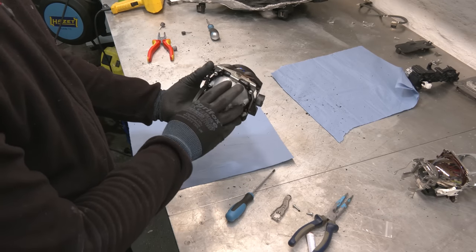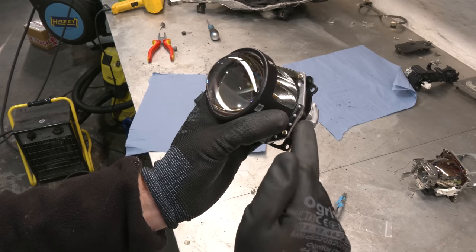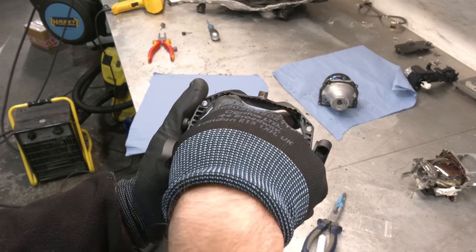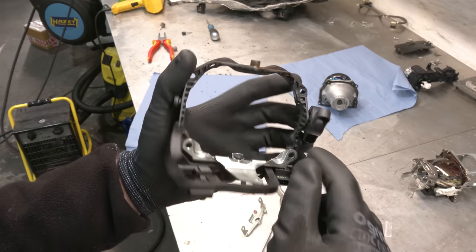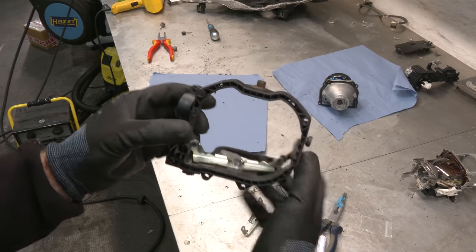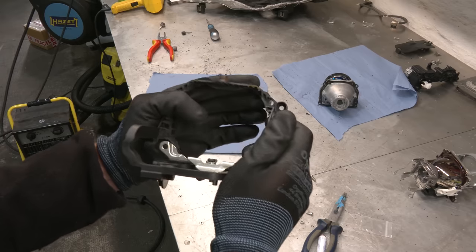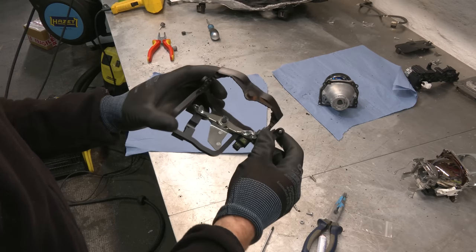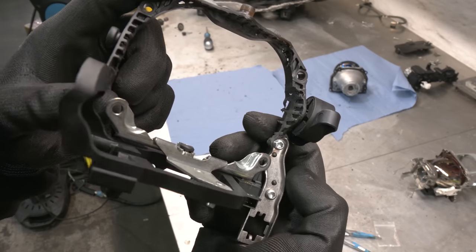With that done, we need to remove the projector, fit this bracket, which we'll also need to trim. In the end, this bracket here needed to be trimmed down, and the plastic adaptive bracket here, here on the top, all around here, and then a bit on the metal bracket on the bottom. So a lot of trimming is needed to fit this projector, but trust me, it's worth it. And thankfully, this is nice thick plastic, so it's still firm, and it's structurally a bit weaker, but you know, it's still strong enough to hold the projector in. It's not gonna break. And this is how to trim down this bracket and the screw.